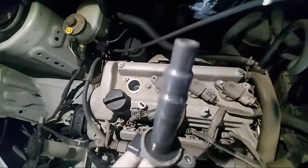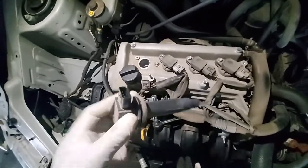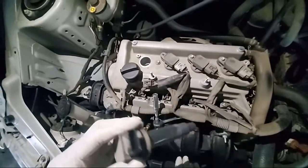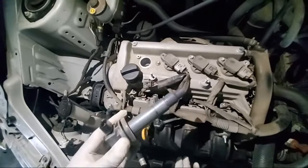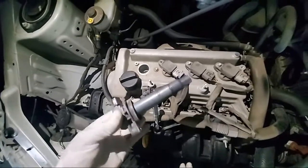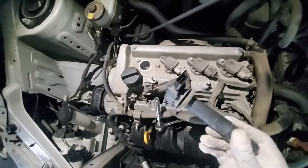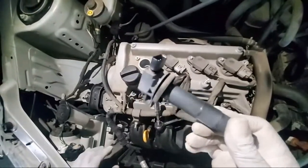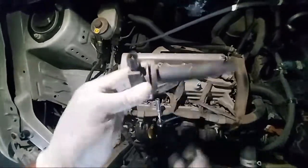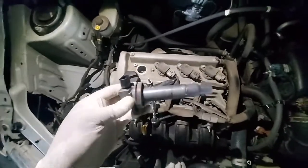This is a new coil pack. Let me tell you a little bit about this. The first time you carried them, you had an igniter — you had an ignition coil. You don't have that anymore because we don't have a distributor. What you find now is that the computer micromanages the system. So all those points and condensers — that business is no more. The computer does all of that.